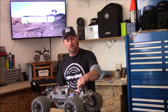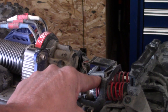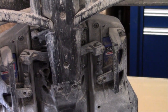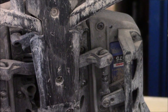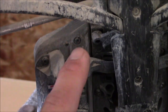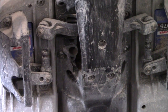To remove the front shocks, first you're going to want to remove your front chassis brace, which is held on by four screws. Turn it over and look on the bottom - there's one of the bolts that holds on the front chassis brace, and the other one is right here. It's exactly the same on the other side, one here and one right there - it's underneath my servo horn right now.